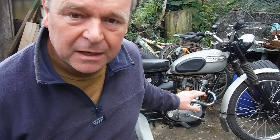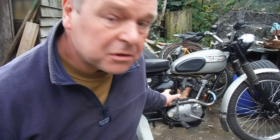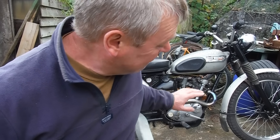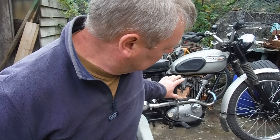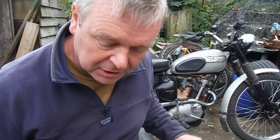The same goes for the Scrambles Cub replica behind me. Everything on that bike is set as you would expect to find in the manual for a 1962–66 Sports Cub. Everything in that engine and all the settings is Sports Cub — it's the full-blown 14.5bhp version. It went very well yesterday. The only deviation from standard is it's got a 107 needle jet in there instead of the 106.